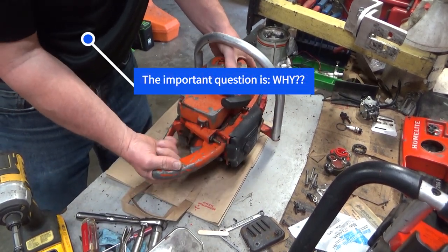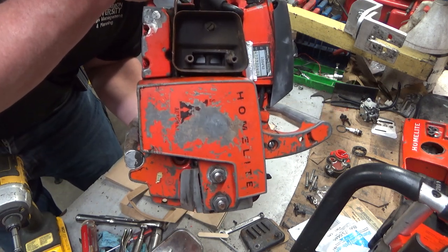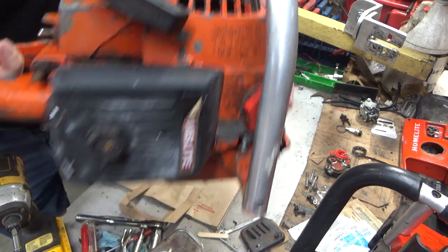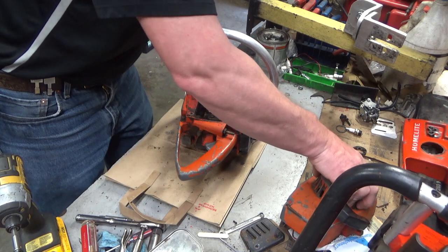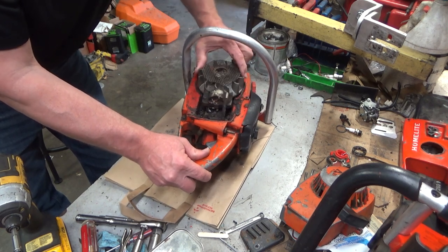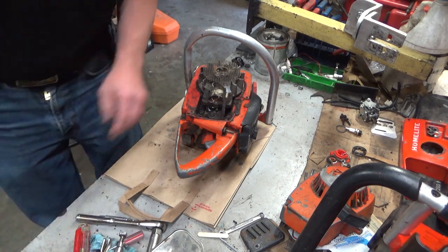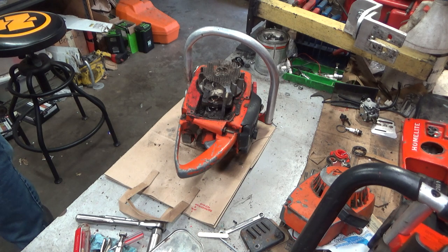I've already got these screws off and I also took the muffler cover off. The piston doesn't look jacked up. If you look in there, you'll see that the flywheel screen doesn't look quite right — it's all tore up. There's a bunch of the screen missing. It spins backwards and then stops, spins forward and stops. I can see down here that there's a piece of that screen behind the flywheel, so I'm at least 95% certain there's a bunch of scarring right here on the coil. Let's get this flywheel off and see what we're dealing with.